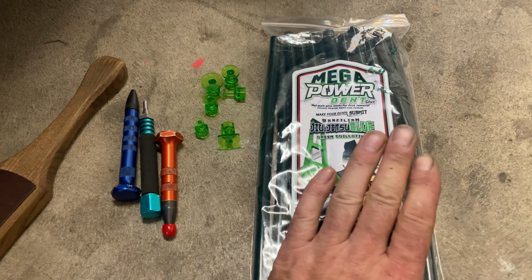with the video. So you can see here, there's just a little low spot that I've got to get up, and that'll pretty much finish up the top section of the quarter panel. And then I'll move down to this smaller section down here, which is kind of a bit of a buckle. It's humped up here pretty good. So we'll push that out and try to relax that down.